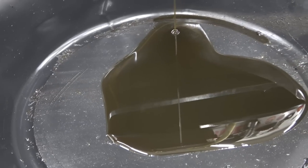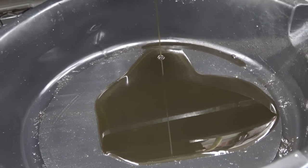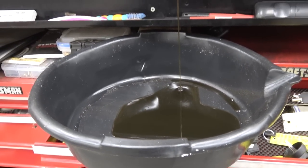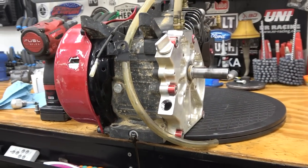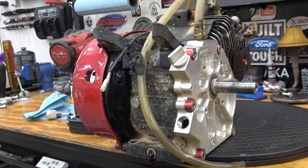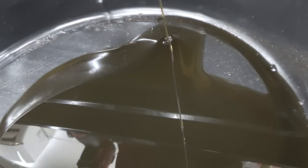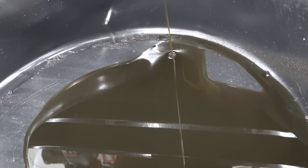The oil doesn't look horrible, but it was time for a change. I would overly change the oil — especially if you're doing a performance build, maybe every 10 hours or so would be acceptable, or less. If you're doing races, I would change it after every race. It's just a half quart, but it doesn't look horrible — it definitely smells like fuel.